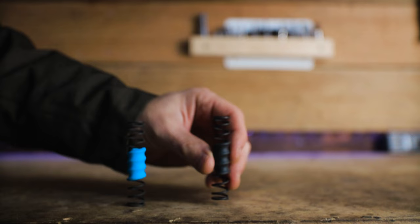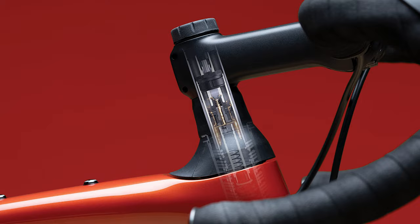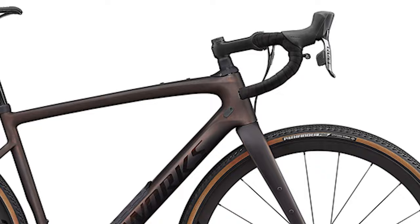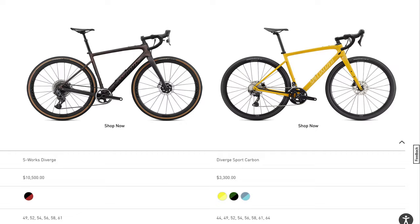While the adjustability of the 2.0 during your ride — opposed to swapping springs before your ride on the 1.5 — is the most noticeable difference, the most ingenious distinction is the technology of the 2.0. The oil-based hydraulic damping system reduces spring rebound on rough terrain, meaning the 2.0 will bounce a lot less than the 1.5. This is not to say the 2.0 is better than the 1.5 — deciding between the two depends on your needs as a rider and your riding style.